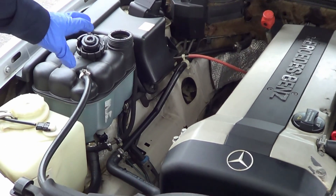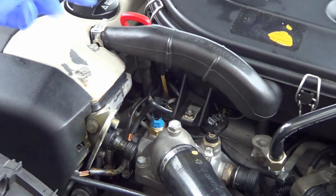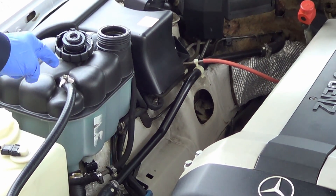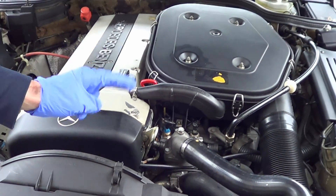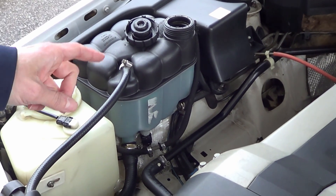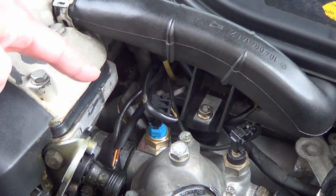That's about as much as has been dropped — probably like a quarter of a cup at most. So we pulled it out of the garage. The idea is you want it to run and you need it to get to about 85 degrees Celsius where the water pump comes on. When the water pump comes on, it's going to force any little air bubble up to its highest point on the car. You can take it out for a drive as well — 10 to 15 minutes on hilly terrain — or put the car on a ramp or hill and idle. That should be enough to get any air bubble out. You're going to want to check the coolant level after a ride, a few days from now, and even a week from now, just to be on the safe side. We're also looking for leaks around that — today, tomorrow, and about a week's time.